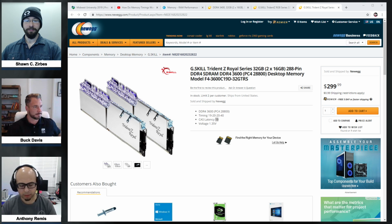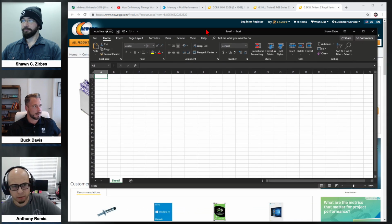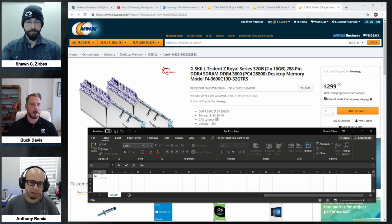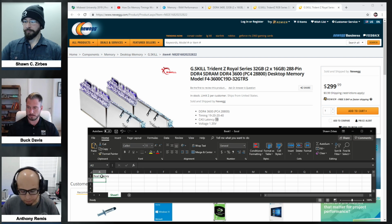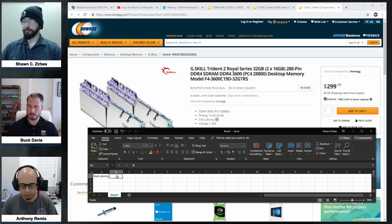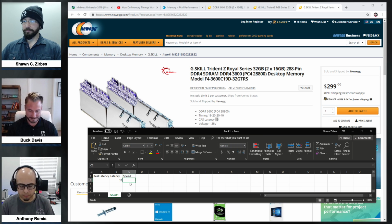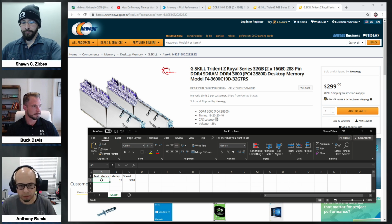Yeah, we could do that. If you want to set up the document, I think this formula was mentioned in the YouTube video you have linked. There's a couple different formulas that you'll find out there. They all kind of achieve the same number though. You get your latency, which would be that 19 or the 14 that we saw. You divide that by your... We'll put in the 19 from this particular page. Cool, and then you get your advertised speed, which would be that 3600 megahertz. That's on the page. So you divide latency by RAM speed, then you multiply that by 2000.